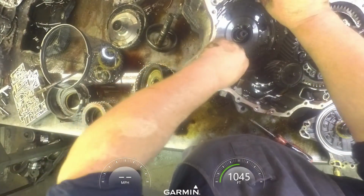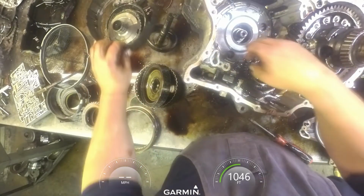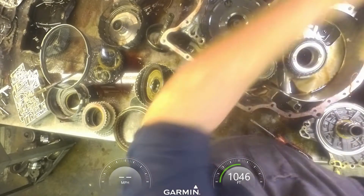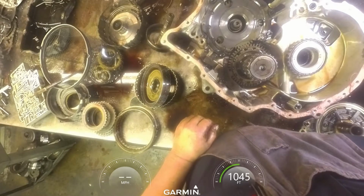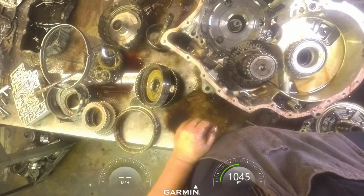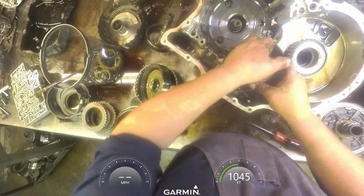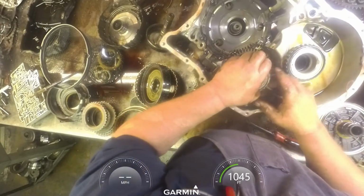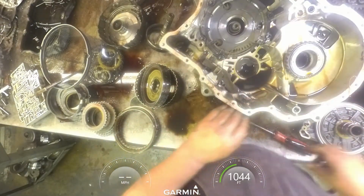And you pull this plate out usually. Sometimes this has a snap ring that holds it in. There, let's see if we can get this out here. There we go. Our diff, we're going to have to put this diff on our transfer case out there and make sure our splines are okay. They're pretty rusty. Now, if we're lucky, we can get this out of here without having to disassemble that whole thing. Good deal. I'm going to leave all of our linkage in there.